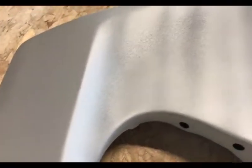A little bit of morning sunshine coming into the crack there. So here's what I wound up with yesterday. If I get the light blocked, you can really see the tiger striping and the dry spray. Couldn't seem to get it to stop. So the next job I'm going to do is hit it with sandpaper, see how it sands, and then I'll see if I need to make another coat or not. Respray it. We'll see, and I'll let you know how it turns out.